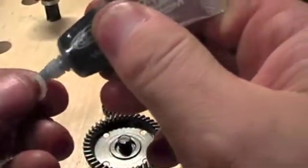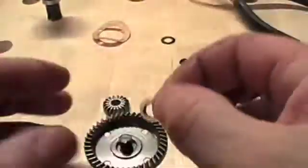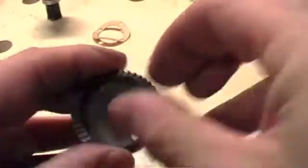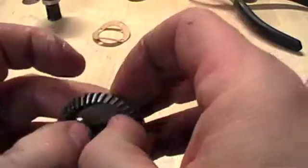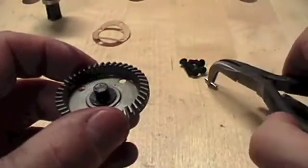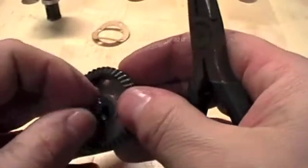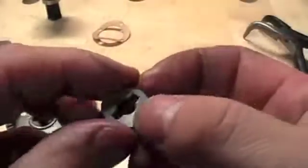Need to lubricate up the second big white clear O-ring. Drop it down over the out drive shaft. Now we can put a shim on top of it, and we can put a second shim on top of it. So with 2 shims down on top of the O-ring, go ahead and put our cross or locking pin in. This side's a lot easier than the other side with it all buried down in the diff housing. Get it about centered, just like the other side.